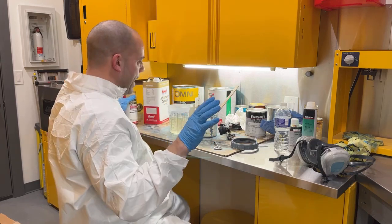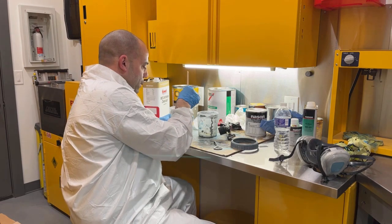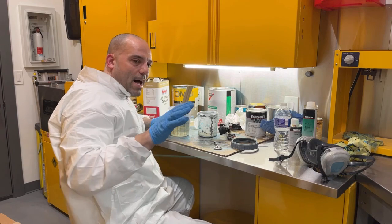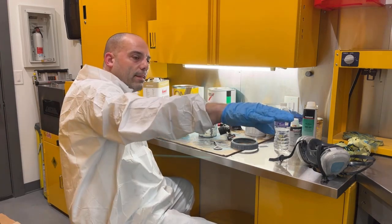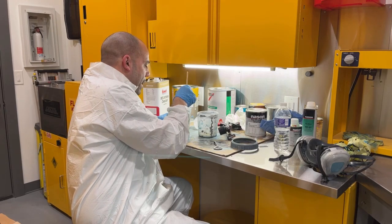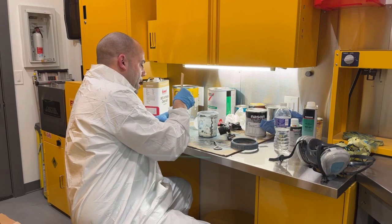You got to be able to paint inside those fins pretty darn good so that it's nice and smooth without creating a run, because it is almost impossible to get the buffer all the way back in there, towards the end, towards the back of the car. The front half's not hard, so you got to kind of get across between.